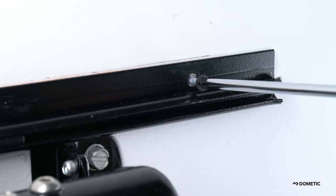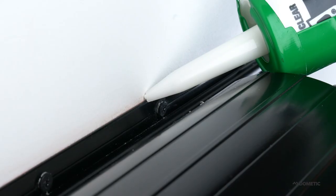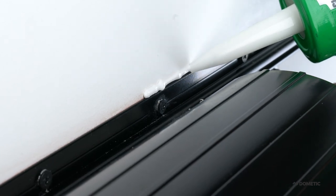Here are a few safety checks to perform at the beginning of every season. Tighten all back channel and awning rail screws. Prevent water streaks by replacing cracked and peeling sealant along the awning rail. Prevent drips by rubbing paraffin wax across the stitching.